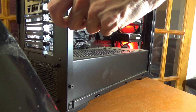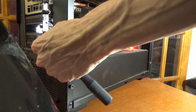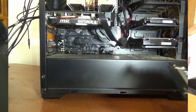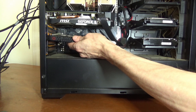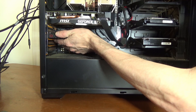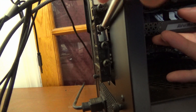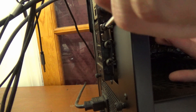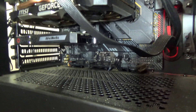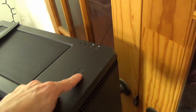If your capture card has a 4K pass-through, you can just use the pass-through or use the duplicate display method. If you have a 4K 240Hz pass-through and you don't play super competitive games, this will be the easier of the two ways. But if you have something like an HD60 or HD60 Plus from Elgato and you're only going to get 60Hz pass-through but your monitor is 144Hz and you want to play super competitively, cloning your display might not be what you want.